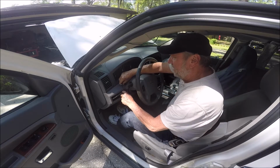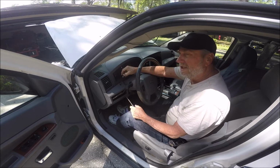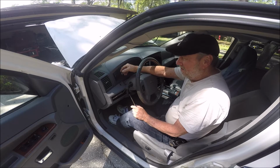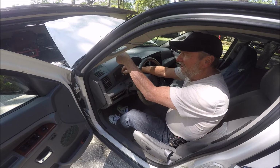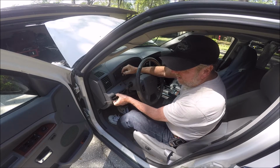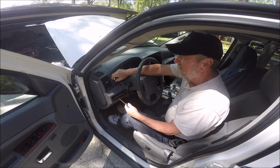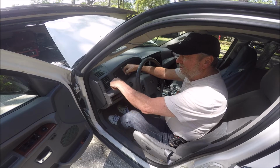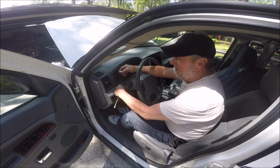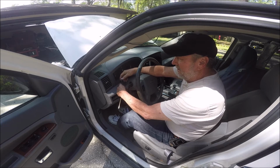All right, I'm going to show you what I did. Right here, there are the two wires that are connected to the contact points that go to the starter solenoid. It's just a straight shot up through there, and you can pull this cover out and actually see where the wire comes in and guide it up through here. You need a 5/8 or whatever size switch you get, and a hole that's recommended for that size, and it'll fit right down in there.